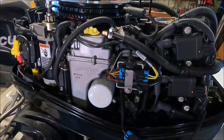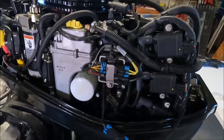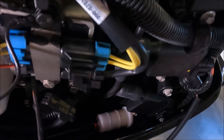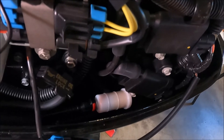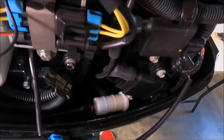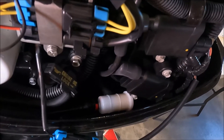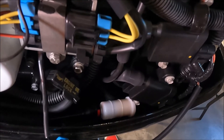The fuel pump is installed and the VST is back in place with all my lines hooked up. The last thing I did was find this fuel filter — it was covered by a sheath and I had to slide it back. Sure enough, I pulled it out and it was full of stale, nasty fuel. So I went up to the store and picked up another filter.